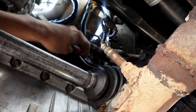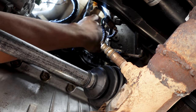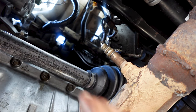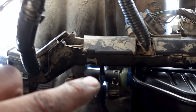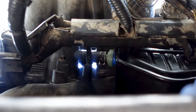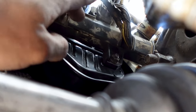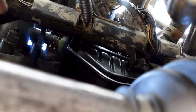The PCV is tightened up. I got the lower bolt, the bolt for the wire harness, and the upper bolt — the upper bolt was probably the hardest. I just had to put my fingers up in there to direct the socket with the bolt and finally get it started with my fingers. Next I connected the PCV hose to the PCV valve down here and also connected it up on the intake manifold — a little difficult to get it started onto the PCV valve but not impossible. The PCV breather box is tightly installed, wire harness installed, and the hose valve is finished.